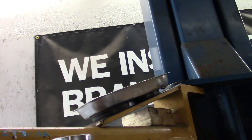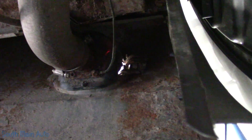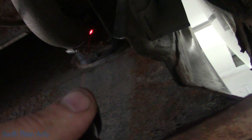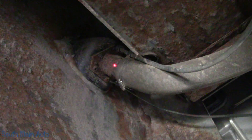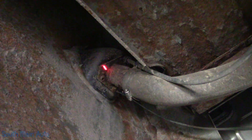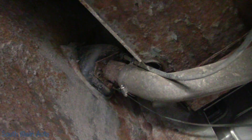There's smoke in this area — you're going to have to believe me. Up in here where it's dark you guys can see it. So we've got smoke coming from up here. I'm assuming that's going to be our source, which is a crappy rusty filler neck. Let's go get some spray and give it a little douche down because it's looking pretty crusty. I'm sure it's either that or it's coming out of the cap and just coming through the plastic housing — but that thing looks like it's seen better days.